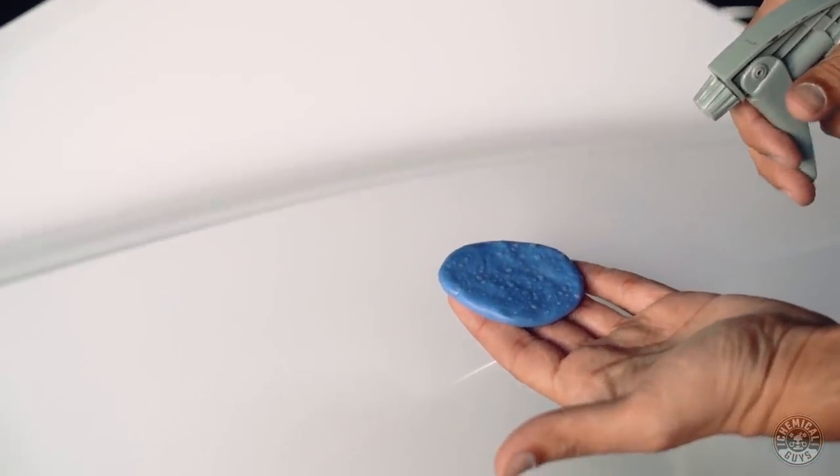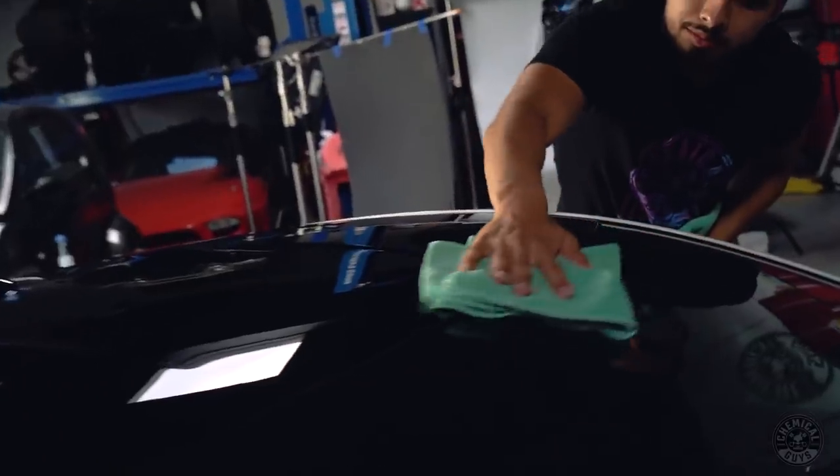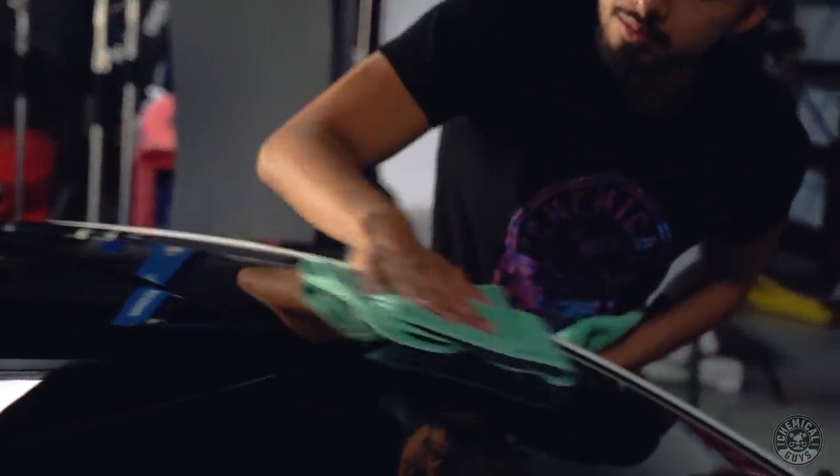Make sure you're using a dedicated clay lubricant — this way you're adding the proper lubrication so it's not marring the paint. If you're unfamiliar with marring, that's a collection of tiny scratches that gives your paint a very cloudy look. This is also helping to cleanse the paint as you clay, so you don't need a rinse or anything like that — just simply wipe off any of the excess. So now we've just finished claying the surface of the NSX, and now it's time to polish it.